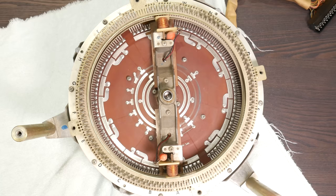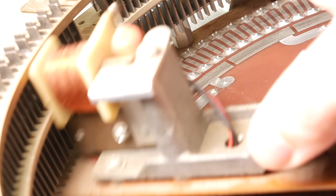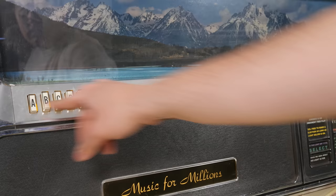When the armature spins around, the electromagnets are reaching down with their feelers and touching every single combination of letter and number patches, and once it gets behind the correct pin, it will find a complete circuit across, say, F and 9, fire the electromagnet, attract the pin that it's right behind towards it, and then the pin will pop up. This is why the buttons need to be held down for the entire selection process, because we need the source of voltage between letter and number button to stay there until the selection accumulator has made an entire sweep.